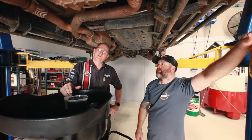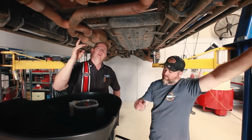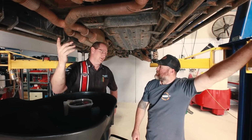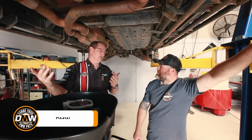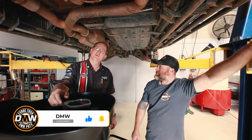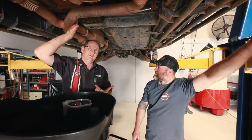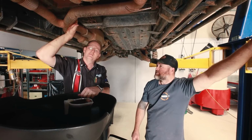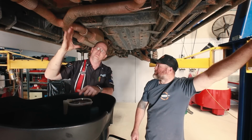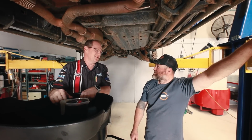Now, when you look at this thing, it's all-wheel drive, and you've essentially got 1.5 litres of oil transferring power to a vehicle that runs 3.5 tonne. So that oil's got to do a lot of work through that box. I'm a big believer that oil's cheap maintenance at the end of the day. Manufacturers that are making fill for life components, I'm not a fan at all. It's just fraught with danger.